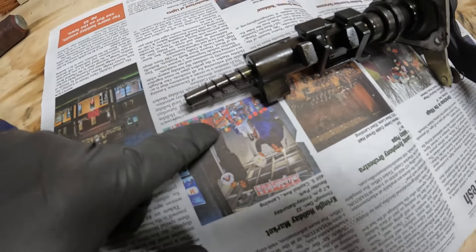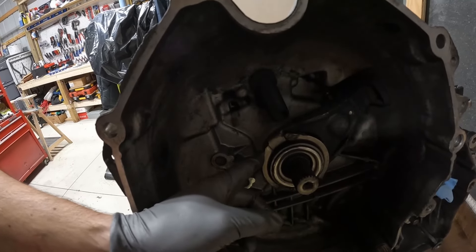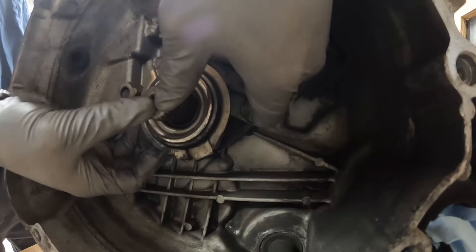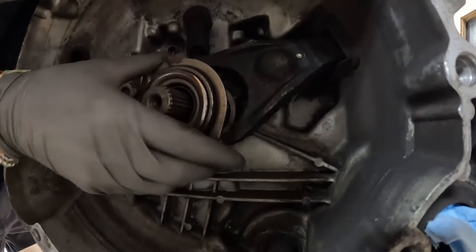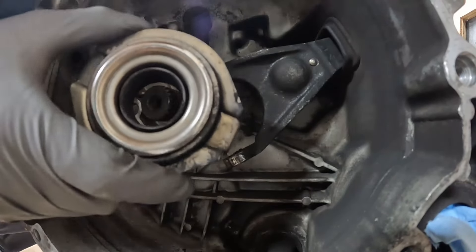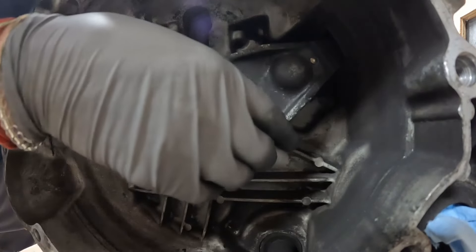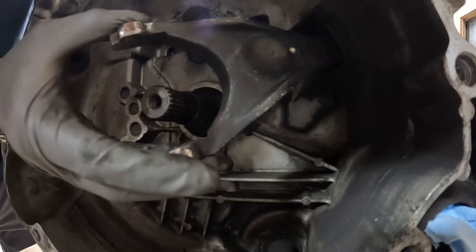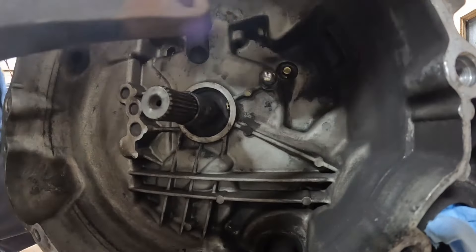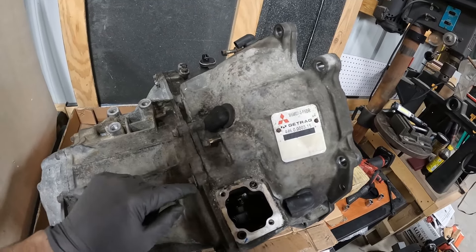There should be a little spring that comes out with it. If it doesn't, you might need to get a magnet in here and just pull it out. On the very bottom piece we need to get to the inside of this bell housing so we can get the shifter fork and this throwout bearing out of here. There's our actual throwout bearing, and then the shifter fork will just come right through here on the inside. We should be good to start working on removing all these bell housing bolts all the way around.